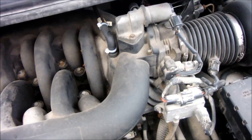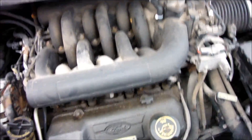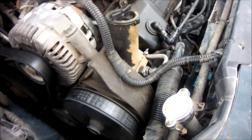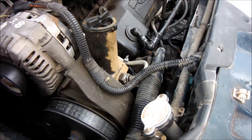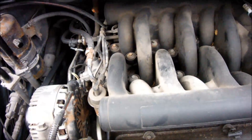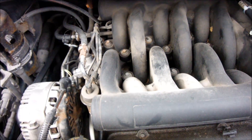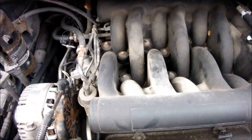I need to run it up to temperature and then shut it off and see where it's actually leaking. It's minus four out — you don't open the rad cap until after it's cooled down. The heater cores inside — there's two of them, one for the back seat and the main one at the front.